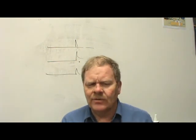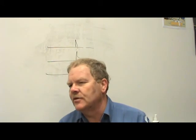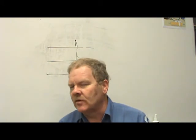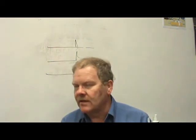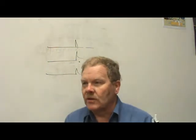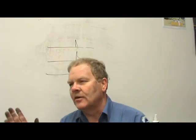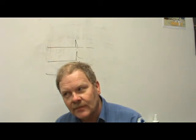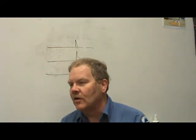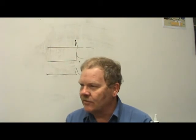The cam sensor? Mm-hmm. I do not really like that question, and I don't like that answer, because basically what the camshaft sensor does is it sends its signal 24 degrees after top dead center, typically. It's going to vary from vehicle to vehicle. But on a Chevrolet and on a Ford, 24 degrees after top dead center, all the fire has gone out. Got it? All your fire has burned out, and so that's when it's okay to spray the next charge of fuel.